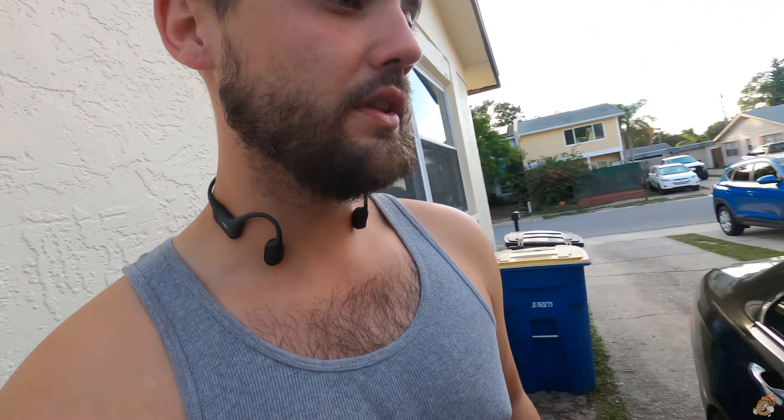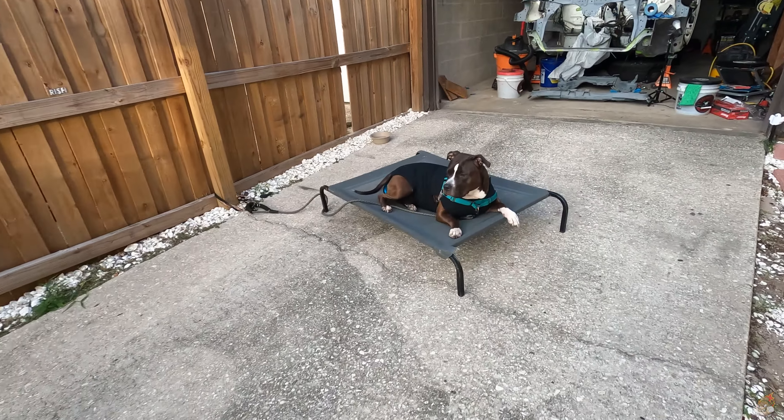I had to adjust the clutch — that's what I'm starting with. I'm only doing like quarter turns at a time so I can really see what's going on. I just know the clutch is done so I've got to replace it. It's been slipping on me a lot more lately, it's hard to get the engagement to start off the line. I feel like I'm basically riding the clutch practically every single time. No matter what I do with the adjustment it just doesn't get right. You know how you're supposed to lift off the clutch and it's already grabbing and initiating and pulling the car — well that doesn't really happen on this one. It kind of grabs all the way out here and then you've got to give it gas for it to really start rolling, so it's just not doing what it's supposed to do.